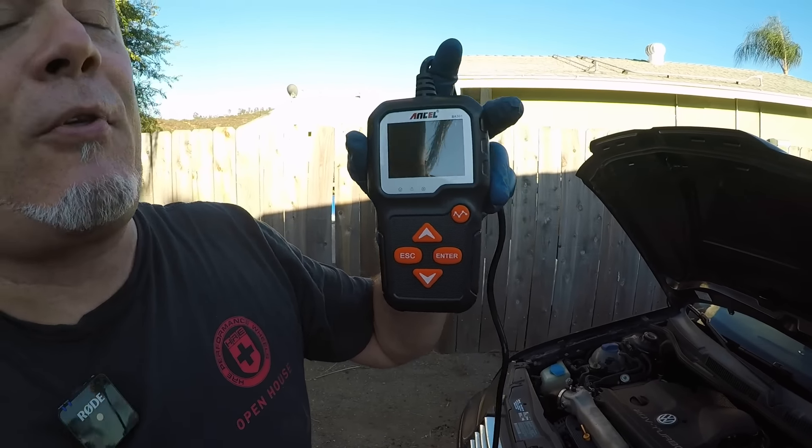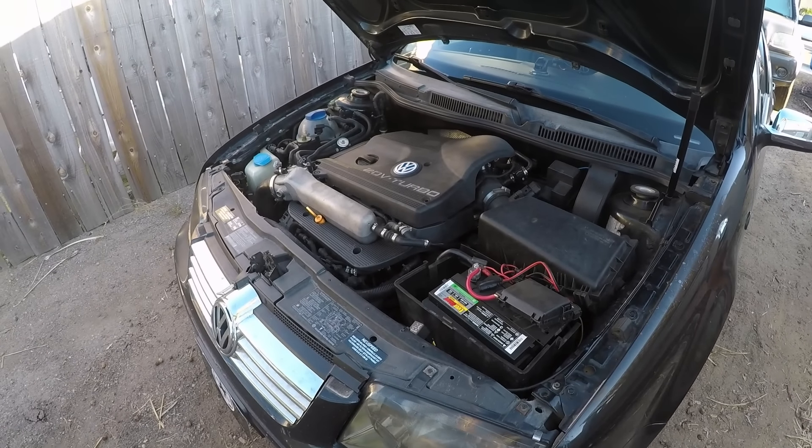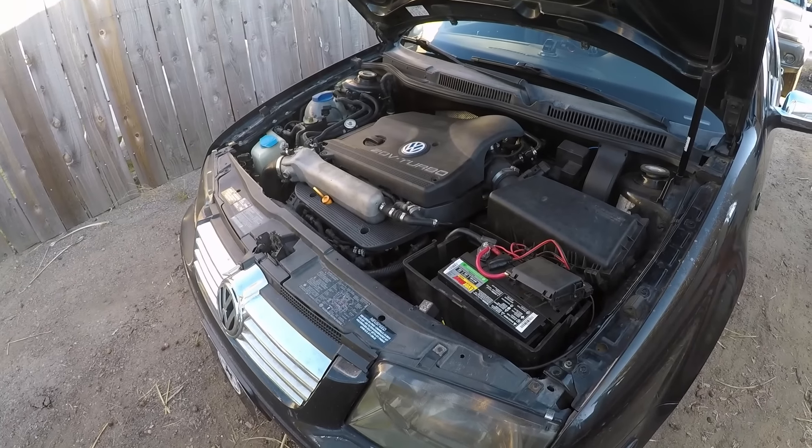Our wonderful, amazing Joan Jetta has a battery drain, and I am going to diagnose the battery drain again. She has had a battery drain before — previously it was the comfort convenience module on the car giving us issues. It might be the same thing all over again, but I haven't diagnosed it yet. In the meantime, the battery definitely has a drain on it, and that could be making the battery life suffer. Let's measure the battery and see what's going on with the car off and on.